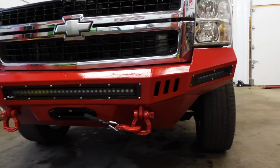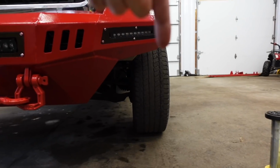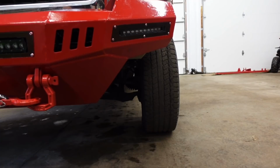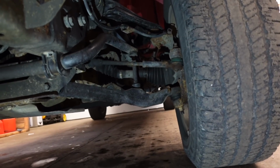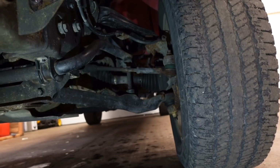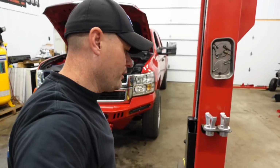What I mean by getting hurt is right on that 0 to 60 boost launch test I just did. You guys can see this wheel right here is now canted out. So I think I bent something, and I'd imagine it's the tie rod. Just by looking at it, it's really hard to tell. What I'm noticing here, and this is my first time eyeballing this, is I'm guessing the previous owner jacked up the torsion key so the front end would go a little higher. The angles on this truck are actually pretty off.